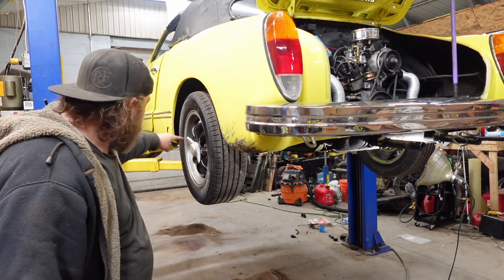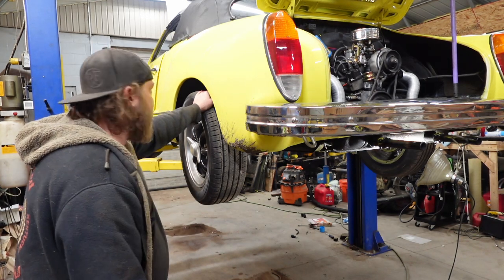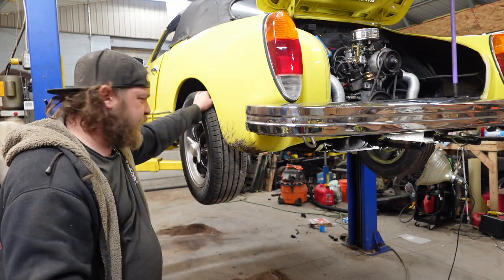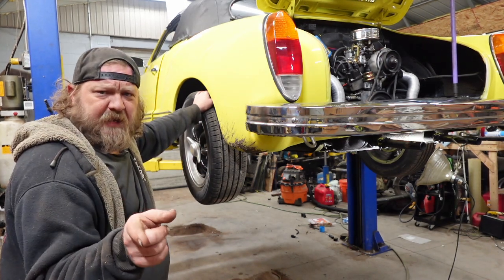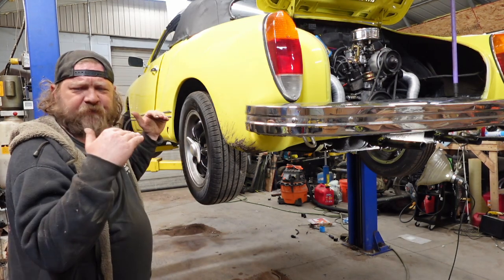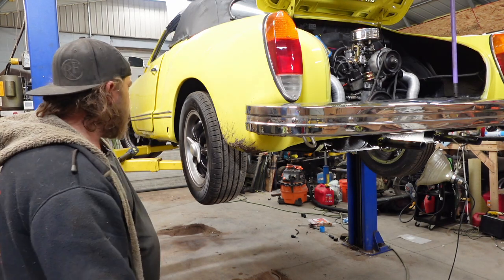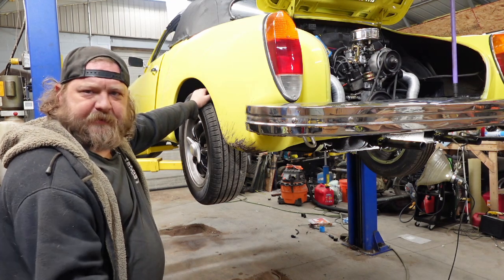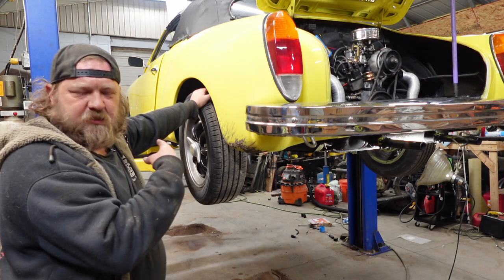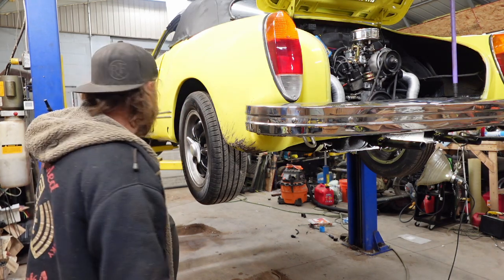I did throw my borescope down this. The lower convertible support rail is just rotted out, so it is flexing. I just wanted to make sure I wasn't crazy by saying something as far as the door flex goes. The other yellow Ghia I did, the 68, full restoration on it. It has all new stuff. You can actually take the body off and open and shut the doors, not bolted to anything. So it's welded solid, or it doesn't flex. I mean, it probably does, but as far as this, no. But all right, let me get these wheels off and we'll do suspension.